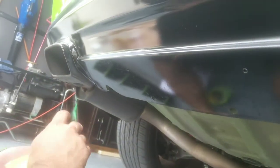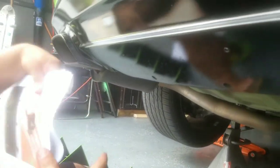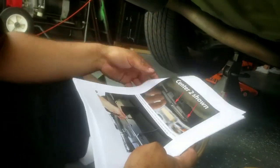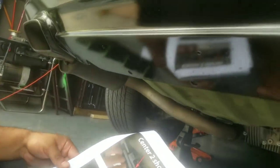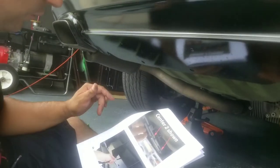Now go ahead and peel your tape back off. It's time to secure your rear diffuser with all the hardware provided. It comes with super detailed instructions and gives you a couple of options on what hardware you're actually using. If you have the center airfoil — the functional piece — you're going to be using different hardware. It comes with everything and you make the choice on what you're using, so just make sure you read the instructions. It'll tell you exactly what spacers you need to put in where.